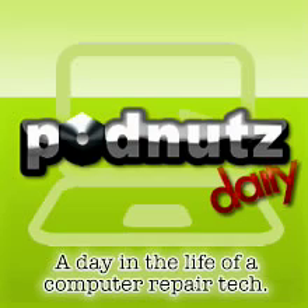Just to make sure, I pulled out a lot of the things connected to the computer, replaced the RAM, pulled out the hard drive. The main thing is to pull out as many components off the motherboard as you can to rule them out. Then I took it outside and blew all the dust out, and that's when I realized it had to be an overheater — so much dust came out of that thing. It's a shame. 13-month-old computer. Now they have to buy a new one or get the motherboard replaced.